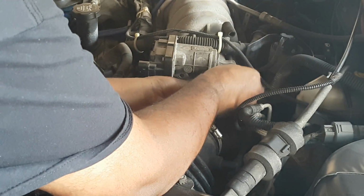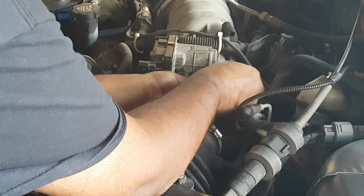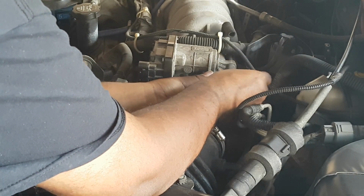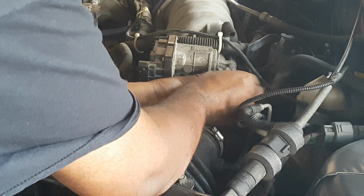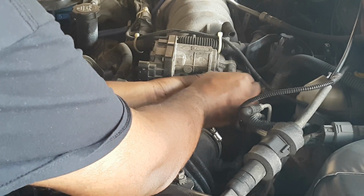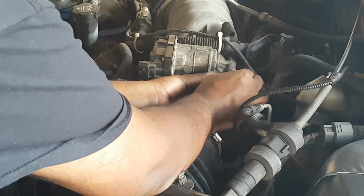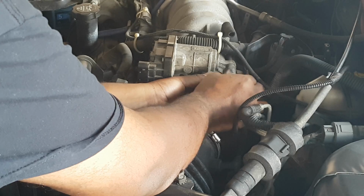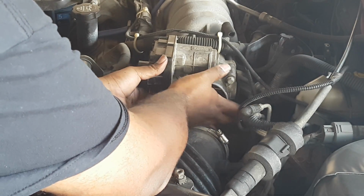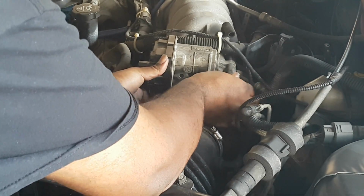Thread it in with each of the bolts here. I'll start by threading this one first. Now, as when I tighten everything, especially when it's a 4-bolt pattern across the corners, I always like to go across. Like if you're doing tires, you know, I'll go here, here, here, and here. Just like if you're tightening tires, 4-bolt or 5-bolt patterns.